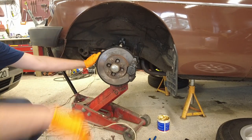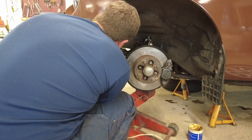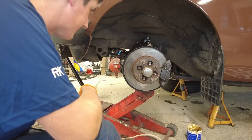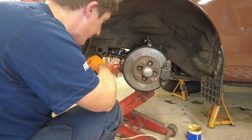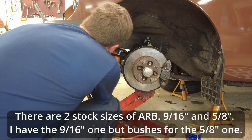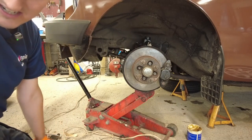Now that it's disconnected at this end there's no tension on that. That bushing is just the completely wrong size - there's about three millimetres of play in it. There are actually two different size anti-roll bars and I reckon it was just replaced with the wrong size one. The new bushings I got are also the wrong size, so I'm going to put the old one back on for the moment. This is definitely a bodge, but I will be ordering new bushes as soon as I'm finished. I'm going to wrap it with foam tape just to stop that annoying clunking and take up the clearance temporarily until I can get the job done correctly. It's not a steering component - it's the anti-roll bar - so it'll be fine short term.